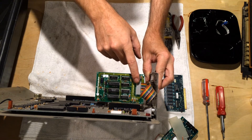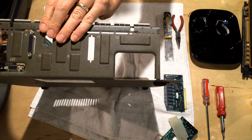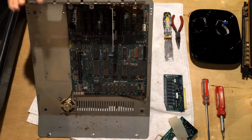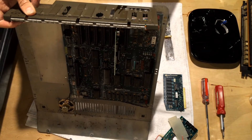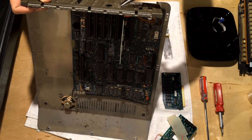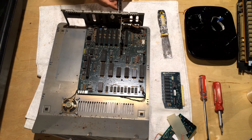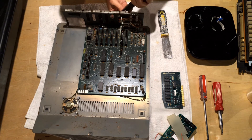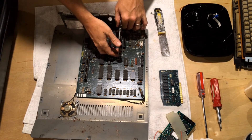The easiest thing to do with the I/O controller is simply to remove the serial port from the back. It's got a couple of standoffs, and there's a tool you can use to screw into those to make removing them easier, but I just use a pair of needle nose pliers. Part of the reason I haven't bothered to buy the tool is because the standoffs when I repair these are usually so corroded and nasty anyway that it doesn't really matter if I end up damaging them. And there we have it — the I/O controller serial port has been removed from the back.